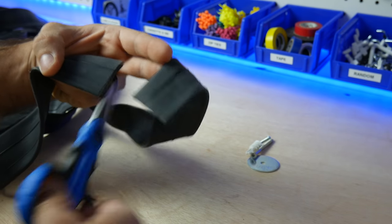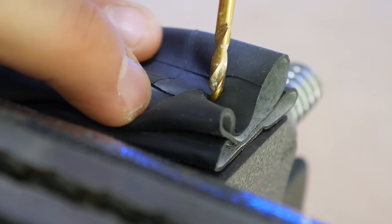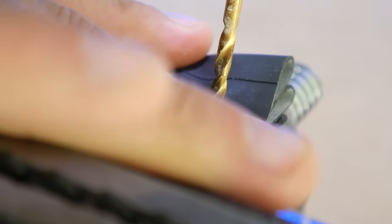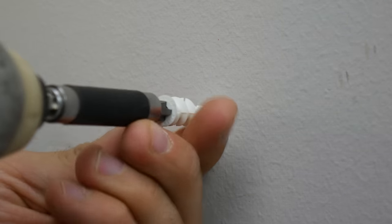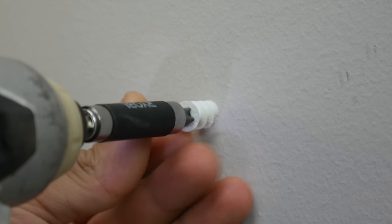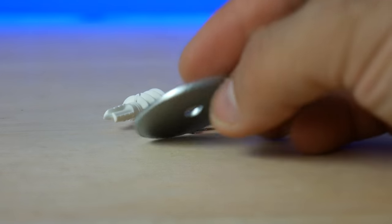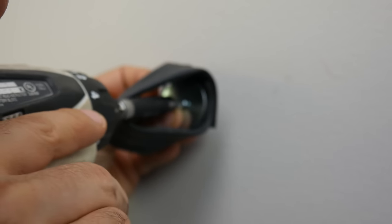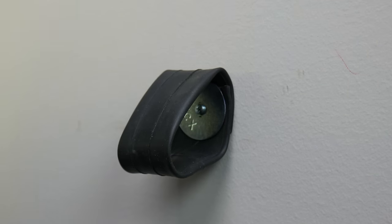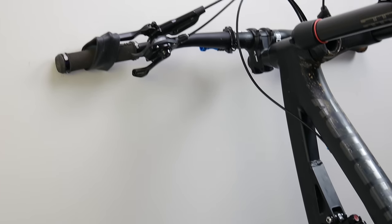You can make a wall-mounted bike stand from a piece of inner tube. Just measure out a piece of tube around your bar and brake lever, make a loop, and put a hole through the end. Mount it to the wall — I'm using a drywall anchor since there's no beam here. A washer will help keep the tube in place. Since the tube squeezes your brake lever, it keeps your rear wheel from rolling, holding the whole bike in place.